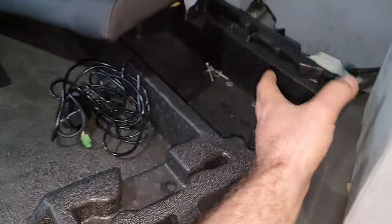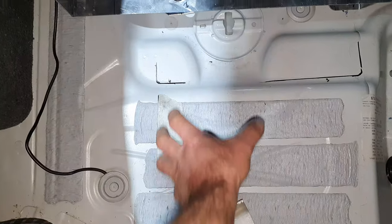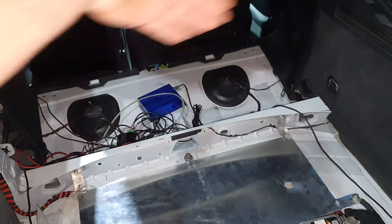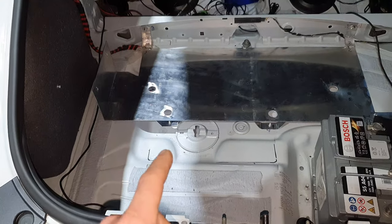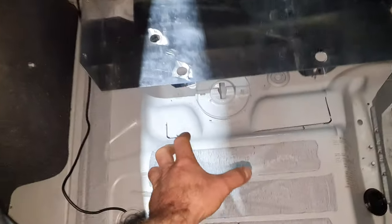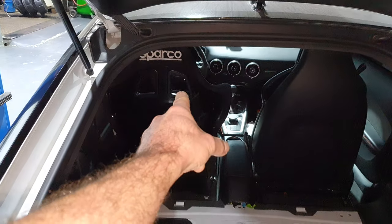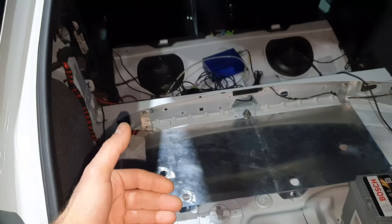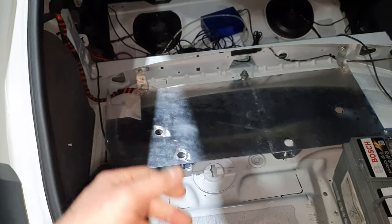Understood? Now, the methanol pump weighs something like a kilo, almost. Maybe a little bit lighter, all right? Before, it was approximately at this point here. So my question to you: it's missing the rear seats, by the way. Do you know how much the methanol pump weighs at 60 kilometers per hour, when you come to a dead stop from 60 to 0, and the pump is located here, in the same line as the driver, without the rear seats? If something happened, do you think that this foam and these 3 bolts are going to be able to hold the pump in place if you come from 60 to 0 suddenly? I doubt it. I'm going to show you this later on.